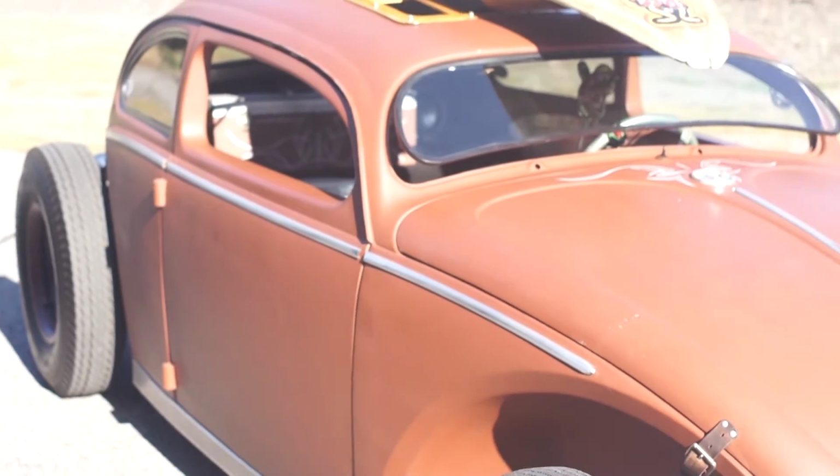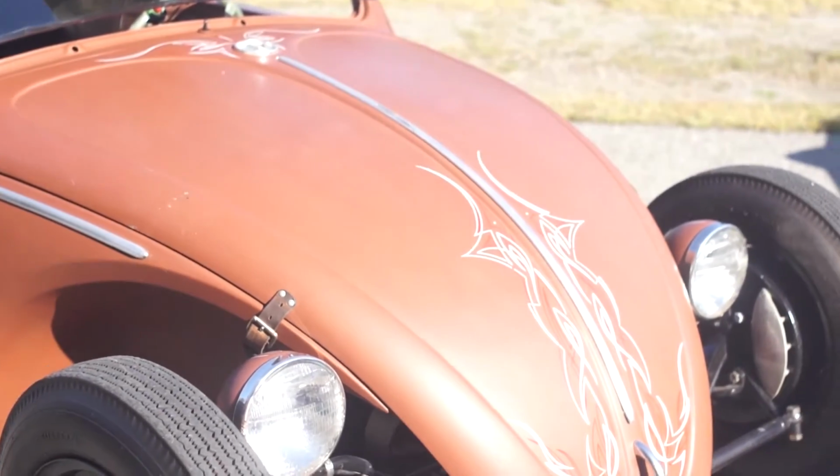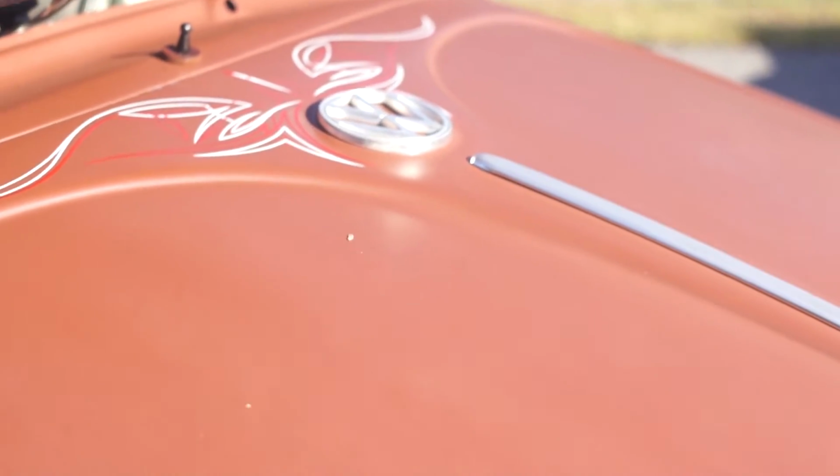Okay, so now, stable. You said a '32 Ford front end. Yep. Now, how do you pick a '32 Ford front end for a Volkswagen? Well, a '32 Ford front end is very common on just about any hot rod you want to build these days, because they're so adaptable for cutting, adjusting, and re-welding brackets where you need them. It's a nice, straight, bare axle to always start with. We cut this one down 1.5 feet to narrow it in. It was actually a lot wider. When we cut it and re-welded it, narrowed it in, then we threw a Ford steering box in on it with the knuckles. I put the A-arms back in, welded that, and then we came around.